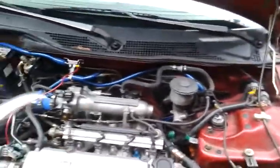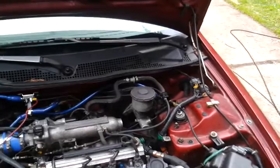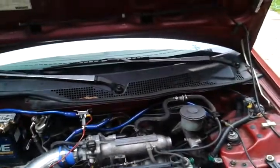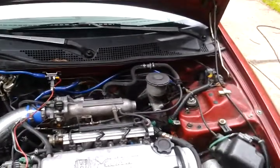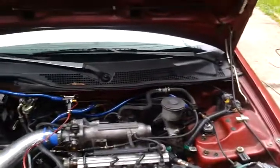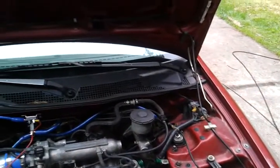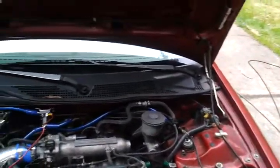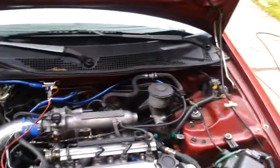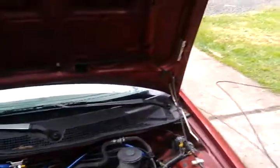I got to do that before the box, because my amp right now works fine, and it doesn't flicker the lights anymore. I've got a battery in the trunk, and with the isolator and the stock 80 amp alt, it seems to be charging everything just fine and not flickering the system. I don't have any clipping anymore, or dimming of the lights at night when I'm booming. But the moral of the story is, before I throw 200, 300 more amps worth of stereo equipment in here, I've got to feed it properly. So I got to put the bigger isolator on there, and then the bigger alternator, and we'll be good to go under the hood for the most part.